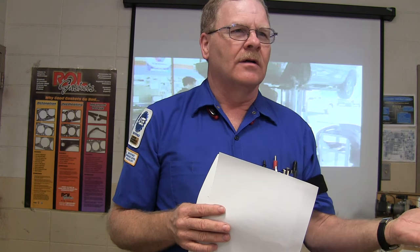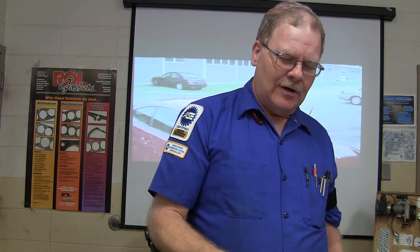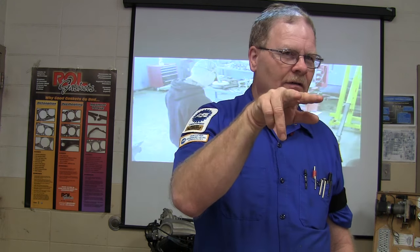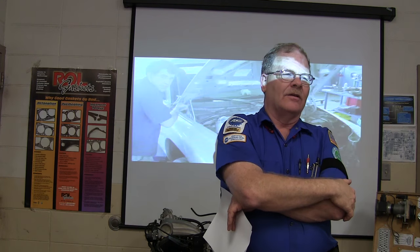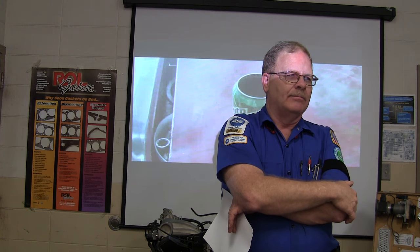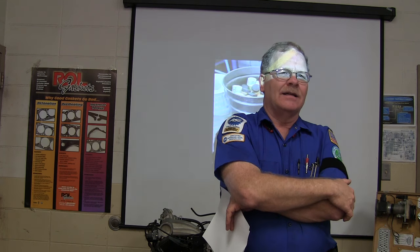So when you boil water, if I'm boiling water and I check the temperature of this water while I'm boiling, like I've got an open pan on the stove, stick a thermometer in it, and I turn that thing all the way up. When it starts boiling, what's the temperature? 212. Can I get it any hotter than that? It won't get any hotter than 212. Because it turns into a gas. What's the temperature of the steam? It's the same temperature. That's the latent heat of vaporization.